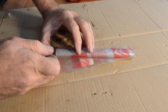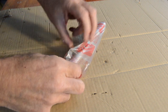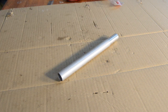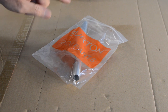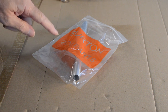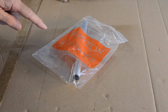The first pushrod tube that's come is a new old stock genuine Citroën one. I have another one on the way which is an aftermarket one — when it comes, we'll compare the two and check relative sizes. The second pushrod tube is from ECAS, made by Burton in Holland. The outside diameter is 0.04 of a millimetre smaller than the Citroën one, which is surprising — normally aftermarket stuff tends to be a little bit bigger. But it's a marginal amount; I don't think it's going to make any difference.